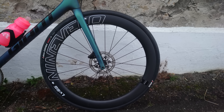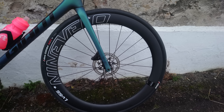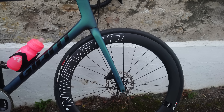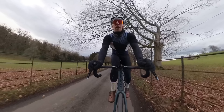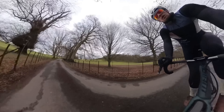These wheels use CX Ray spokes, which are my favorite. The lower-end wheelset uses the Sapim Race blade, which is a slightly thicker gauge spoke that should make for a slightly stiffer wheel. I'm glad I've got the CX Rays — the spring constant of a CX Ray is quite low, making it a fairly soft spoke, which suits my riding.